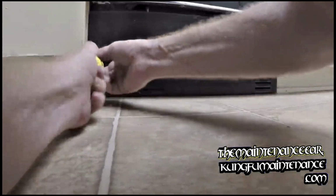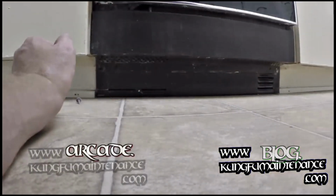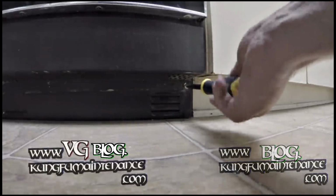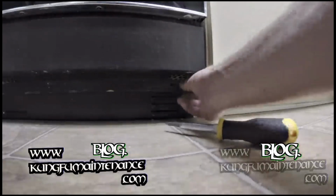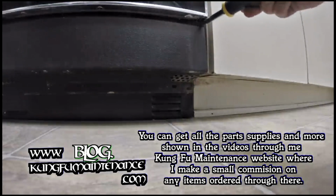So it's a good idea to unplug the machine or disconnect the breaker or turn off the breaker. At the very least, having the door open, the unit shouldn't turn on without the door switch being engaged. But to be extra safe, you can unplug it. And we usually got 4 screws that hold these bottom trim on.